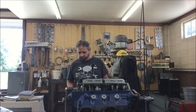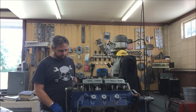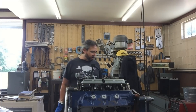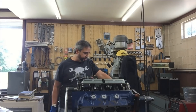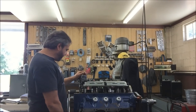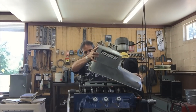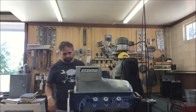That ain't going nowhere — perfect. I love turning this over and looking at that crank, everything moving. Definitely precision, no doubt about that. I may try to see how I can get these core plugs out — looks like it's a three-quarter inch. I've got the oil pump all tight, that's looking damn good. Everything's got good clearance. Here's my oil pan — I'm just going to leave it on here and lock it up, make sure it doesn't hit. It's getting there.